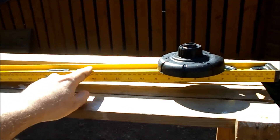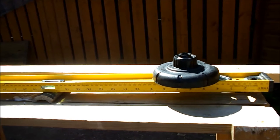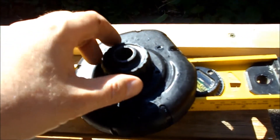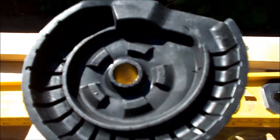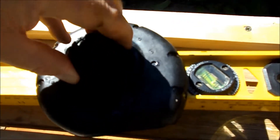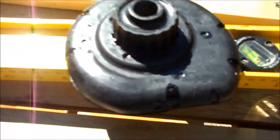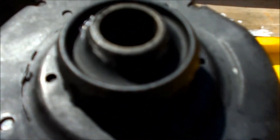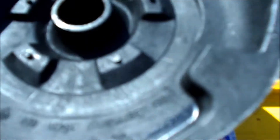In short it's a seesaw, and like when a parent and child are on a seesaw, the parent has to sit closer to the fulcrum or pivot point in the middle, because the mechanical advantage to the child means the seesaw balances. I used a broken curved bit of a concrete tile to balance my spirit level on, because helpfully it has distance markings on its 900mm length. You could just use a plank and any suitable lump to put under the middle point as a pivot or fulcrum, then you just measure it.